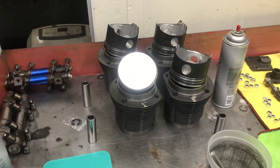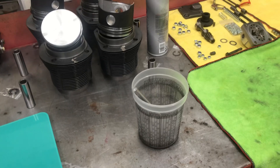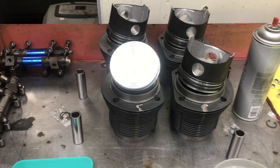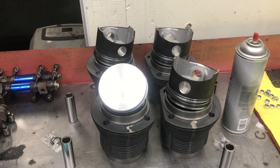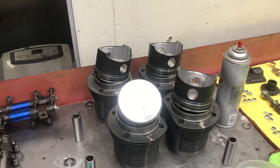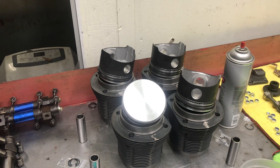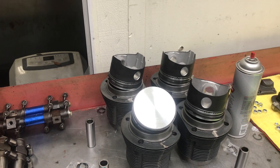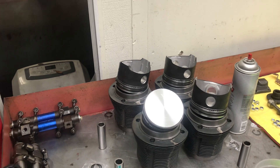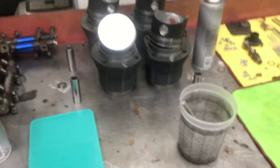That's just a little pro tip. I don't know how much it'll extend the life of the motor, but that's a lot less metal in the motor after the initial fire-up. It wouldn't take long for that to be in the oil circulating through the bearings. Run a bead hone through there and set your ring gap - usually around 16 to 18 thousandths. If you know you're gonna run hot, open it up to 19 or 20 and you'll get a lot longer life out of the cylinder. If you hone it, you're setting piston-to-wall clearance - you can measure with a feeler gauge and make sure you have a decent amount so you don't scuff the pistons on fire-up.